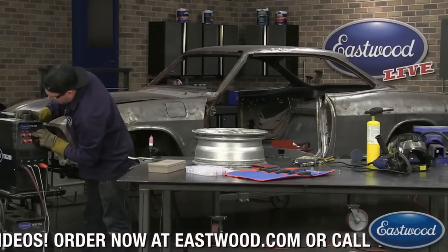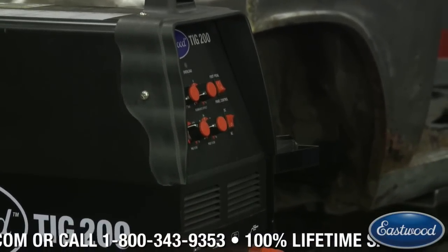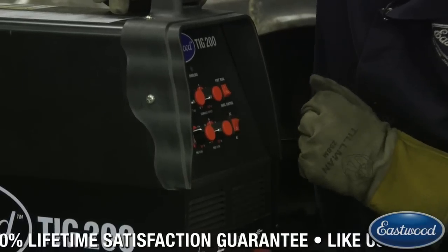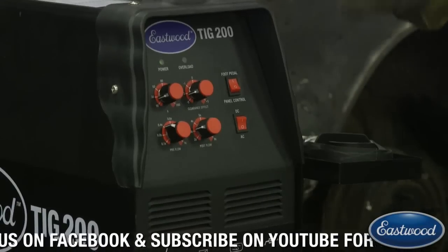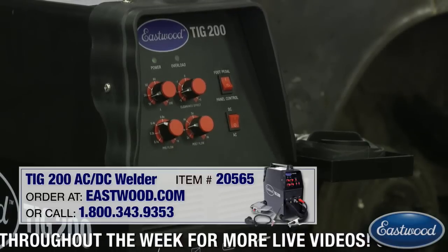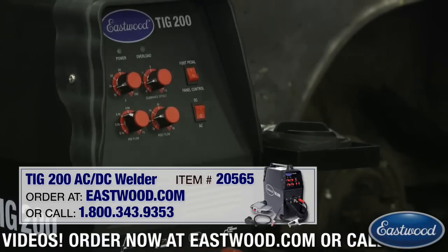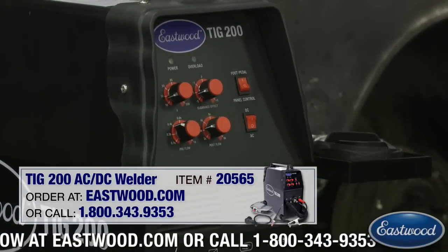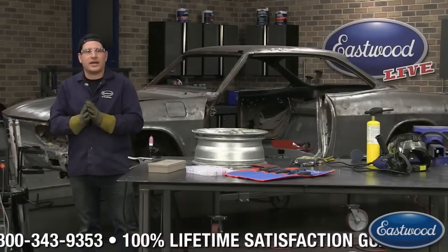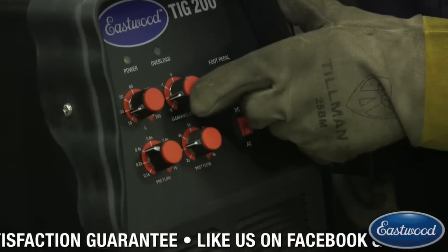I've got it on AC. I have the clearance effect set and I haven't welded on this wheel yet — I wanted to show you what it's like doing this on something you've never welded before. We're going to have to figure out the clearance effect. I have it set at about negative three on the clearance — that's going to keep it a narrower arc and put more heat directly into the piece. I want a nice tight arc because we're trying to fill this area. I don't want it to be too wide and heating up a big area. The downside is we may have to balance it out — depending how dirty this metal is, when we start welding it may call for us to go a little more towards the positive side because it'll have more of a cleaning effect and a little wider puddle. But I'm going to try and keep it pretty tight and narrow and see how it works out as we strike up an arc.